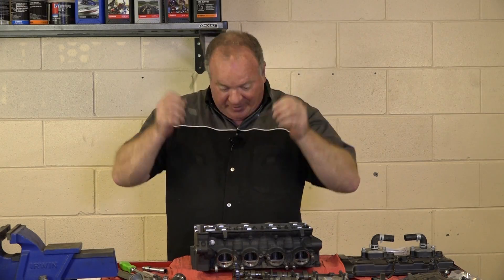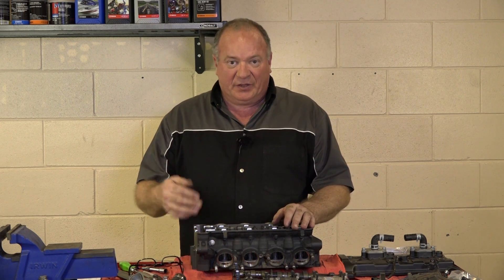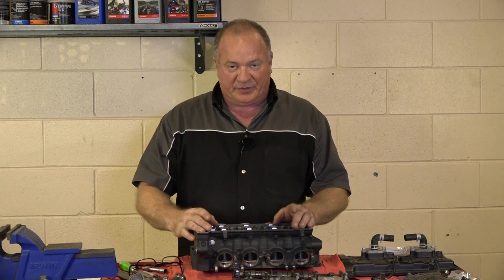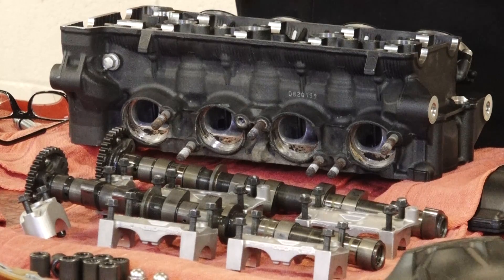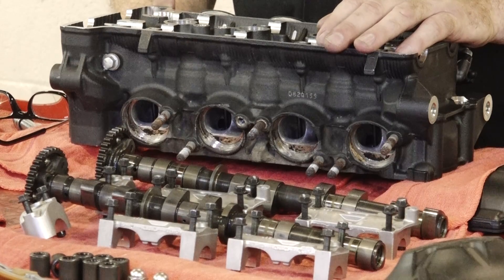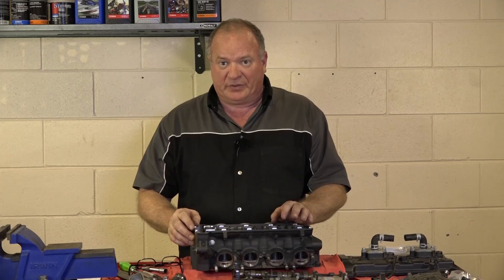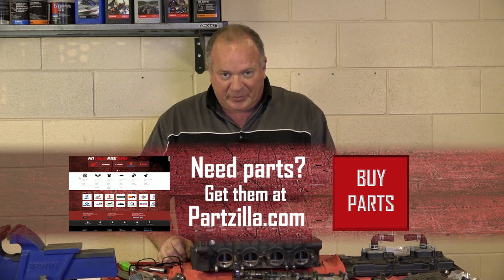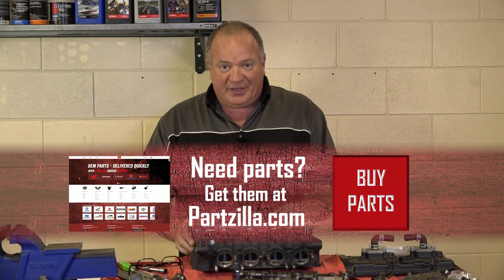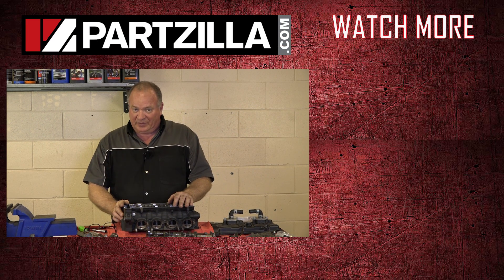Well alright guys, they are all set and ready to go. So what happens next? You didn't have to pull the entire head just to do a valve adjustment like we did. So if your motor is still in the frame, all you'd have to do is get your cams back in there, set your timing, and then put the valve cover back on. Reference our video on how to set the timing and I can walk you through that step by step. When you're making these measurements, you want to measure twice and only order the parts once, because these shims are kind of expensive — last thing you want is to have to order two or three more just to get it set right. When you're ready to order your parts, come find us at Partzilla.com. If you have any questions or comments, leave them in the section below and I'll do my best to answer them. Until next time, thanks for watching.